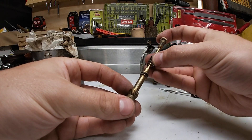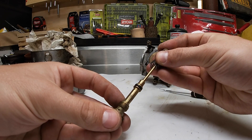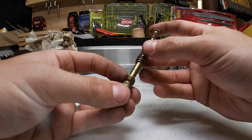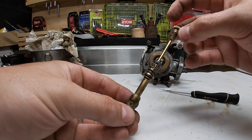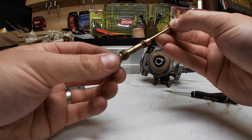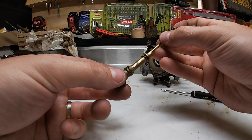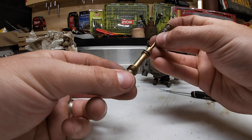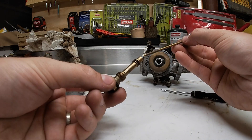When you crack that throttle, fuel flows up here, comes out the top, and gets sucked into the engine. When you adjust this screw like I was showing you, you're in theory raising this needle up and allowing more fuel to come out. It's literally that simple. Depending on what you're running for pipes, intake, or elevation — if the bike's starving for fuel, a couple flicks of the wrist and it'll be running normal again. This is why I love old school engines. You're more connected to it. With fuel injection, ECMs, and oxygen sensors, it's all taken care of by the computer. I love stuff you can actually adjust.